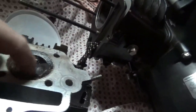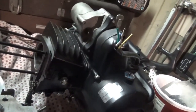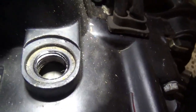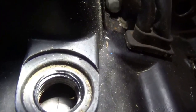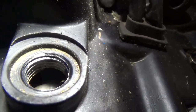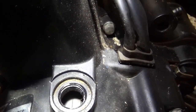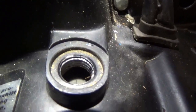Where do you start? You start with the piston all the way up. You can see it's down right now - the valve's closed - and we'll check the timing marks and get everything set up. To time the engine you need the piston up, and you take a look in there and you will see a line and to the right of it a 'T' - that's when you know you're at top dead center. You want to be perfectly at top dead center; there is a little bit of a null so get that right. Line up with the T to the right - be careful, don't line it up with 'F' or you'll be too advanced. That's the first step.